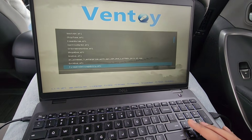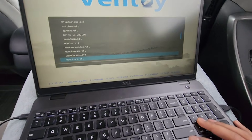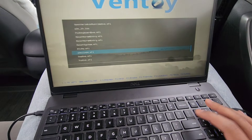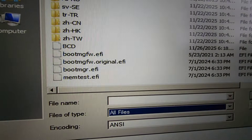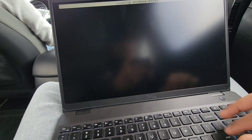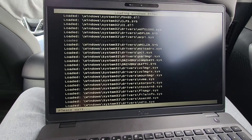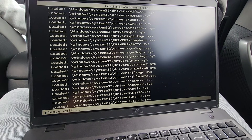So I tried going to the EFI shell. In the EFI shell, let's try copying UEFI7 to the Vista installation — I had only copied it to the installer, not the actual Windows Vista partition. I tried doing that and then checked safe mode to see what files are being loaded. UEFI7 is now present on the EFI partition, so hopefully that helps.